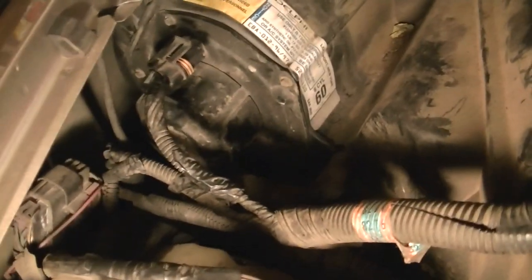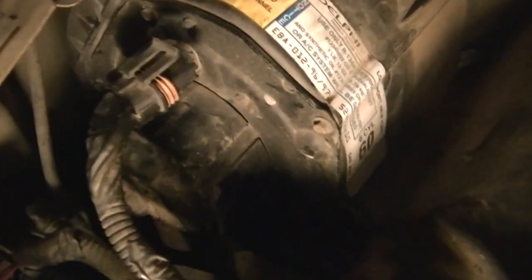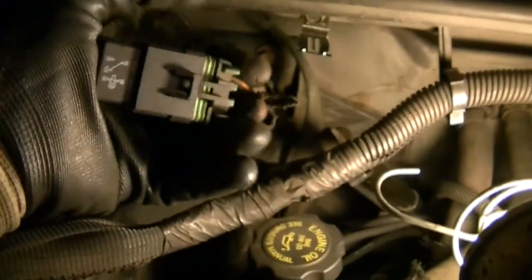All right, got our blower resistor bolted back in there — it's brand new from a few weeks ago. Now we'll hook up the relay here and fire this thing up to see if that took care of the blower being on all the time. I'll caution you — when we start this up you're probably going to hear that motor squeaking a little bit because it is now time to replace it. It was stuck on high all the time which has probably burned up the bearings. We simply plug this harness together and push up and slide down.